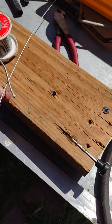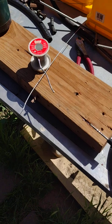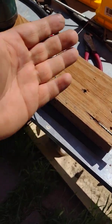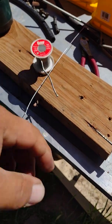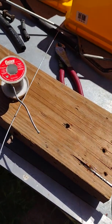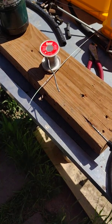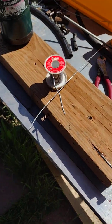Now, I am not going to use this for a brake, like on a mountain bike or even a motorcycle. Just squeezing that pressure, whole lot of force. It's amazing. That cable could snap, which then will result in an injury. So you will not do this project on a brake cable. You'll only use it for a choke or a throttle. So I see that would be safe.